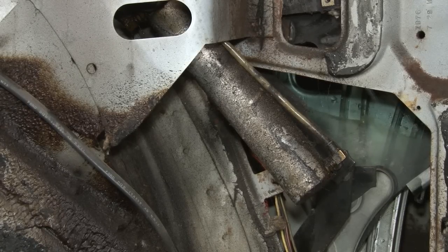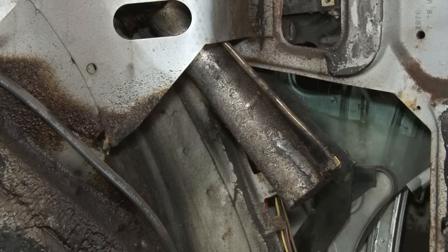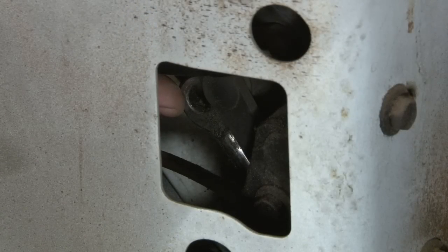We see a lot of fluid on the floor on the driver's side, which is where we thought the problem was. We're going to hit the switch to see if we can locate where it's leaking. And there we can see it's leaking from our upper fitting. We also noticed the driver's side clevis pin was missing from our convertible top. The pin is what actually connects the cylinder to the top itself, allowing it to push the top upward. In our case, it was just pushing against the top and not pushing it up, which probably also led to its failure.